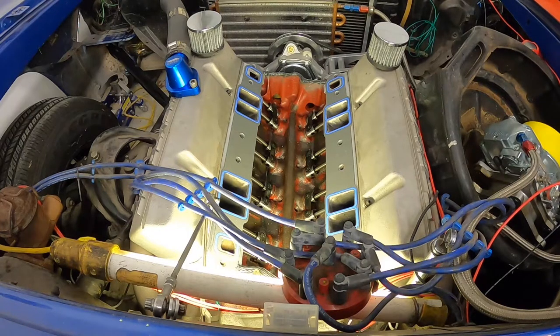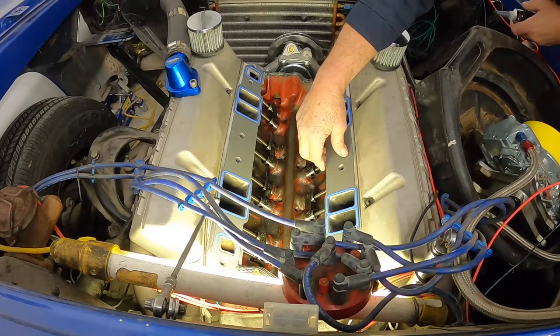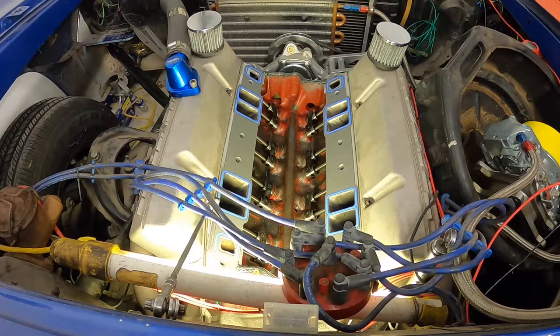And with the aluminum stuff, aluminum moves, and this just seems to be the best. I've definitely put it through the test with the late model engines, especially when you've got aluminum heads and aluminum intakes sitting on top of a steel block, so much change in size and shape in the dissimilar metals. You take a late model engine that's running around at 7,500 to 8,000 RPM for 20 minutes solid, and temperatures vary. We run as high as 260 and keep running. Holy smokes, things are moving. And those are still liquid cooled? Yeah, that's liquid cooled, and they'll take it.